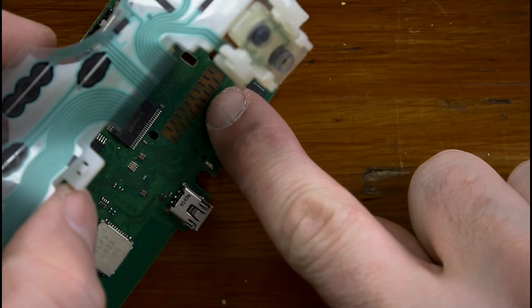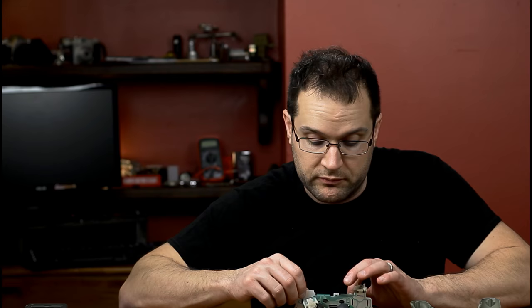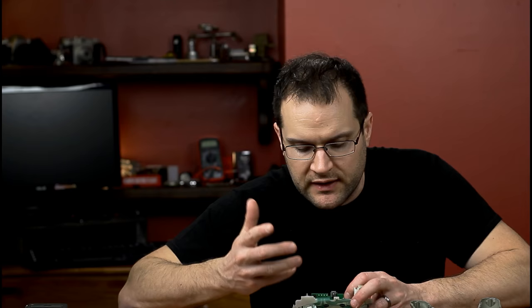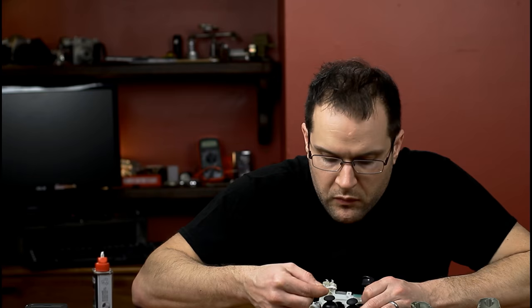Once you have this part off, the next critical part is the connection between the board and this little ribbon cable that really goes to all the buttons. That connection tends to mess up a little bit and make the controller act just a little bit crazy. Sometimes I just flip this black piece around and you're good to go. Sometimes I have to replace that black spongy piece — you could replace it with anything you have, or buy a new replacement piece. That's usually the culprit for all the controllers that I've tried to fix.